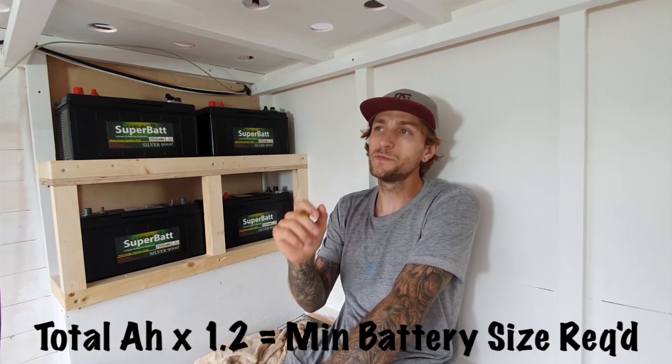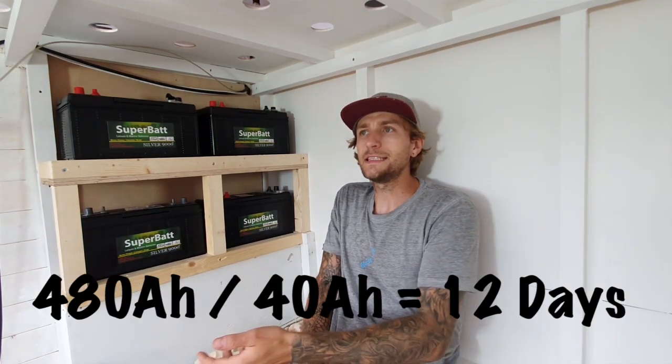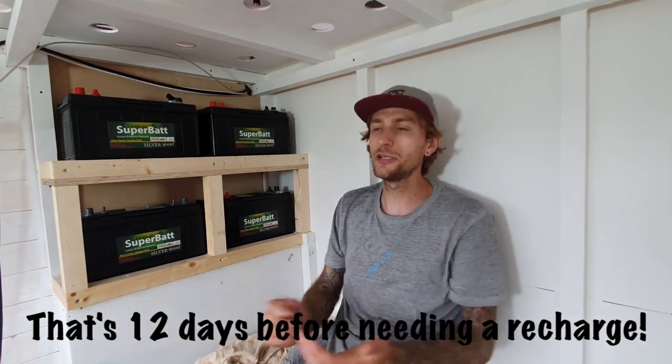Get all your amp hours — your power consumption multiplied by the number of hours you're using each item — add those all up and then add about 20% to give you a safety margin. That gives you your total amp hours between cycles. When I worked out my van, it came to about 35-40 amp hours. So with a 480 amp hour system, 480 divided by 40 gives me about two weeks off-grid — if I use everything to the calculations: lights five hours a day and so on. That'll give me about two weeks of complete off-grid energy before I have to go for a recharge.